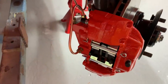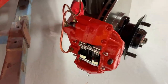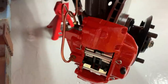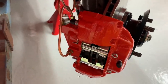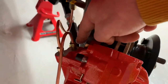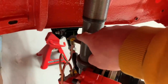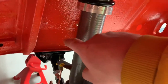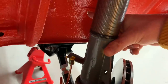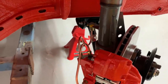While we're on the subject of brake calipers, I thought I would discuss the requirements for piping these calipers up correctly. For those of you fitting Austin Princess calipers, you'll probably be aware there are certain ways these calipers can be piped up. Option one: I've run a link pipe from the brake pipe fitting up to the innermost fitting on the flat face on top, then a link pipe from the innermost fitting to the bracket on the strut, and then a flexible braided hose from that bracket to the body.